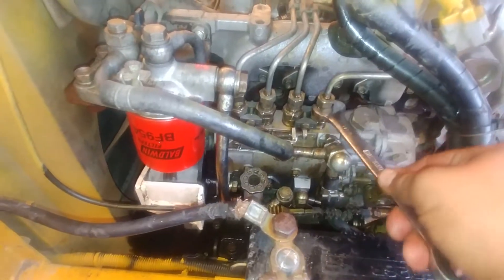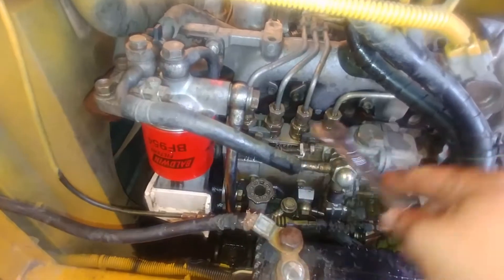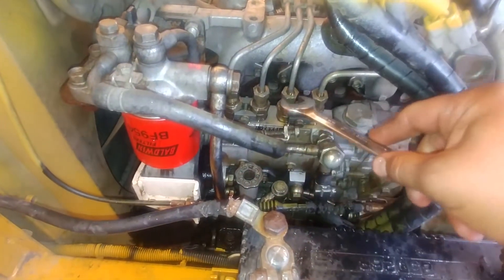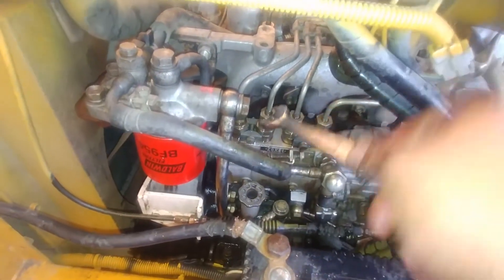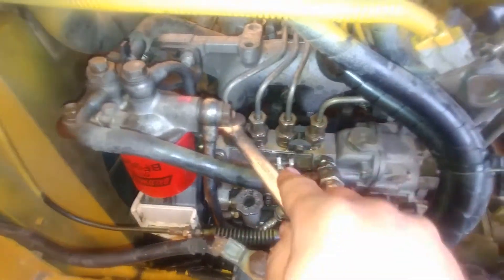Because we don't have air in the filter and we don't have air in the pump, we've got all that air pushed out from the lower end all the way through the fuel lines to the injectors. Isuzu diesels are pretty easy to prime — they will almost start right up as soon as you get rid of the air from the fuel injection pump.